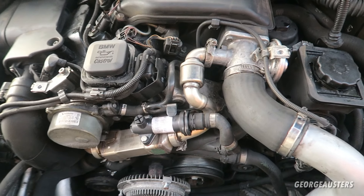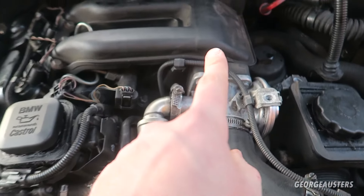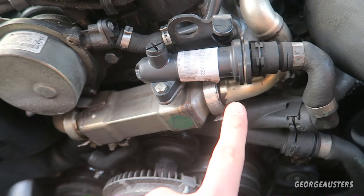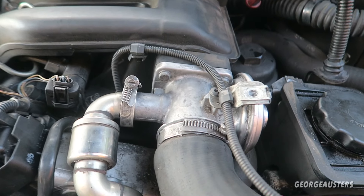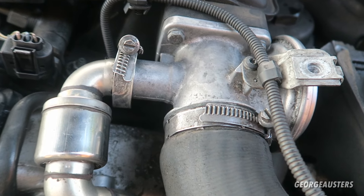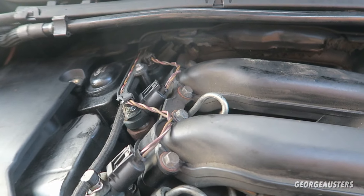The next common problem affects pretty much all diesels regardless of engine type, and that is the EGR valve. If you don't know what an EGR valve does, it essentially recirculates exhaust gases back through the air intake to be burnt off again. Because you have sooty exhaust gases going from the exhaust manifold through an exhaust gas cooler and back into the intake, it clogs up quite a bit. Combined with crankcase ventilation vapours, oil and soot coat the entire intake manifold and intake ports in a sticky mess.